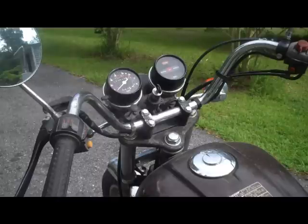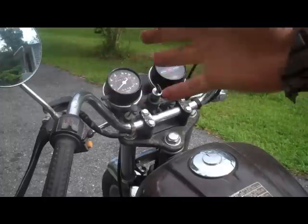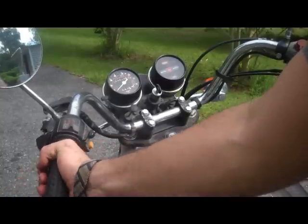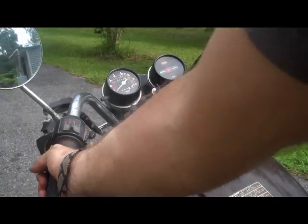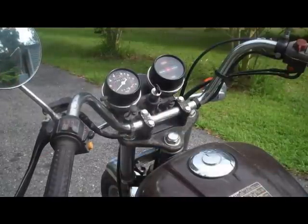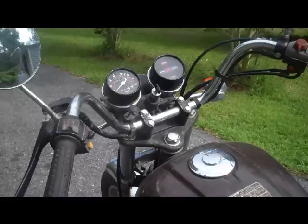We're going to put the bike in second gear — sometimes third gear is even easier. Get the bike going down a hill, and once it gets up to maybe eight or ten miles an hour, just pop the clutch out all the way. We're just coasting down the hill with the clutch in, then pop the clutch out all the way and the bike should just sort of turn on. Be careful because you're going to rock it forward, so don't dump the bike.